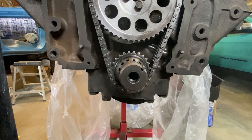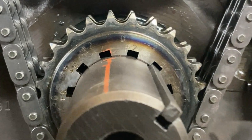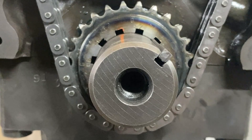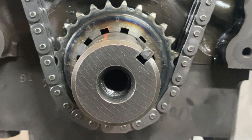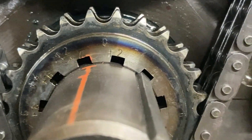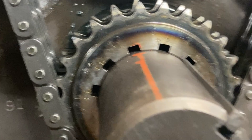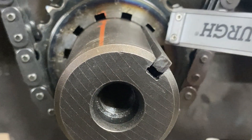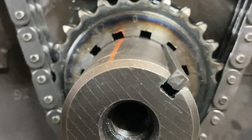That's about what it's supposed to look like. It doesn't look right - seems like that should be shallower, or the key should be bigger to fit all the way at the bottom. But it doesn't, and it doesn't even go all the way up into the timing gear. But that's what it's supposed to look like. Supposedly if it sticks up any further you could shear it off - that's why they want most of the key to be down in that shaft with only a little bit sticking out.